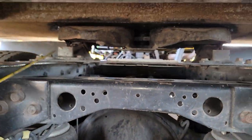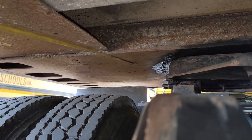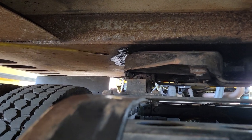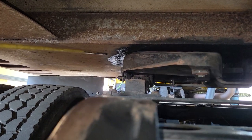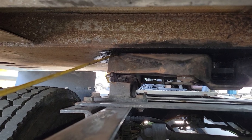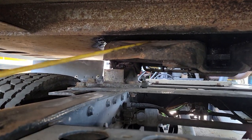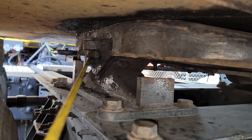Over here we have our apron — no liquid, holes, weldings, no rust, no cracks, good condition. My apron and my fifth wheel should have zero space between them — zero space. My fifth wheel should have a lot of grease, well greased.